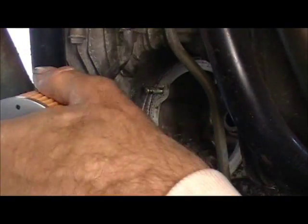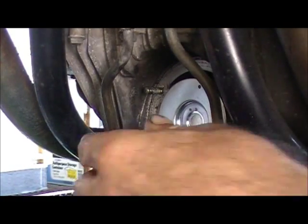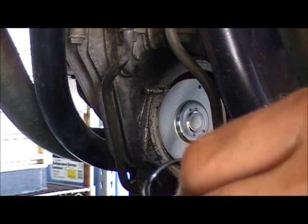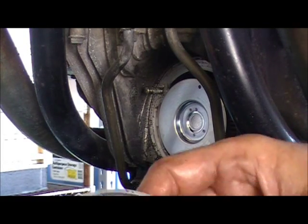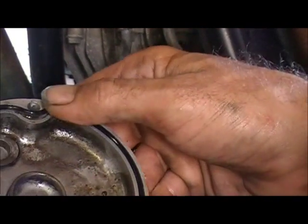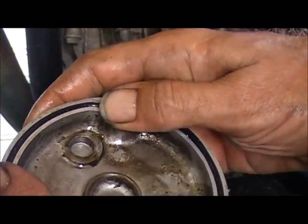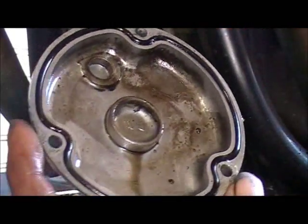Just stuff the O-ring in the same bag — that's why I'm doing it this way. Usually I'll put the O-ring in my cover first. Go ahead and get that sucker in there. There's an O-ring in here; half the time you've got to peck it out, the other half the time it just falls out. Work that sucker in there with your thumb. Make sure all those little grooves line up and fall in, and make sure it's seated so it's not going to pinch itself.